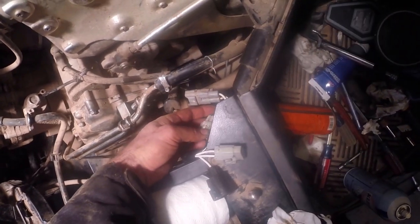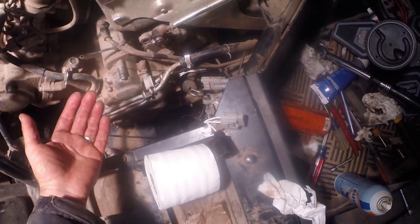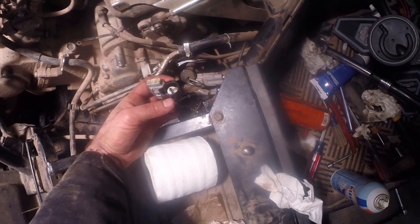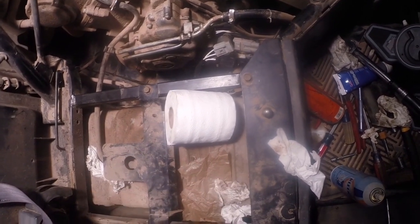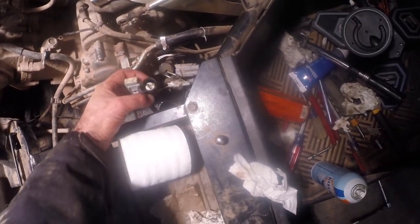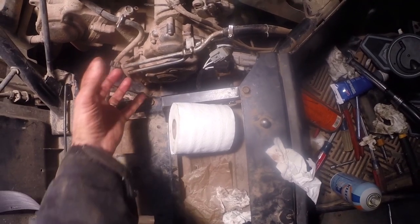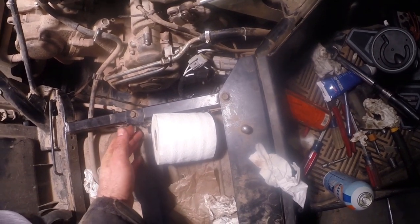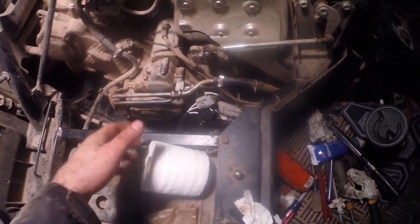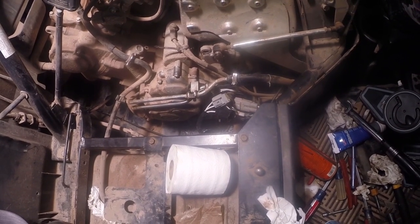I also connected the electrical connector for the crank pickup. We're going to start the engine and measure the AC voltage on these three wires - hopefully we'll see an equal voltage but much higher than the 3-4 volts we saw before. I would not want to run it very long with that disconnected because while doing that the alternator creates a high voltage since there's no current draw off it. It's fine for a quick test but I wouldn't want to drive it like that. We also put the oil drain plug back in and the water pump drain bolt back in.